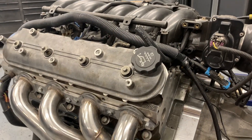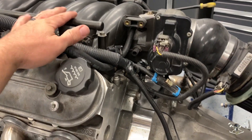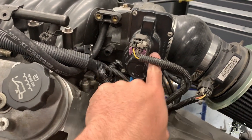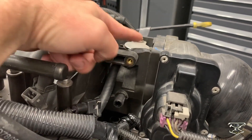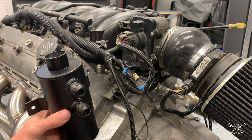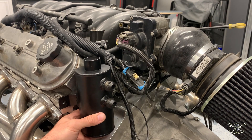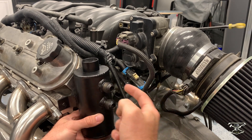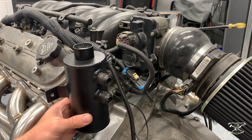Just to show you what we're working with — this is a 5.3 truck motor. I put on the LS1 intake manifold, so it's flipped unfortunately because I have a transaxle attached to it. To make this work with the truck electronic throttle body, we had to make some provisions up top for the fresh air breather. Looking at mounting this catch can, my initial thought was I'd be able to just bolt this thing right to the head, however the AN lines are facing forward, which means I'm going to have to come up with a whole bunch of angles and elbows to get it back to these two breather ports. So that's probably not what I'm going to do.